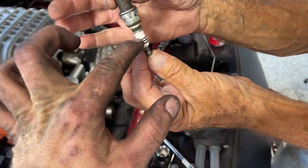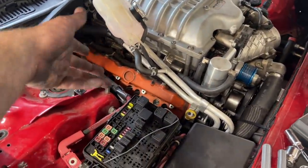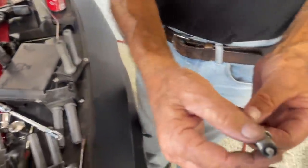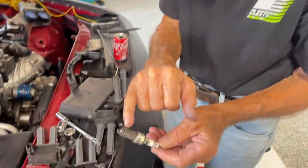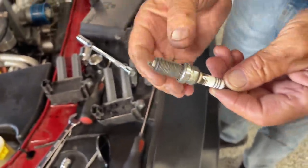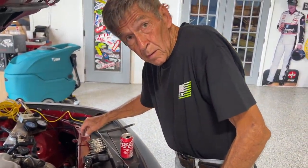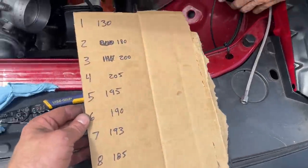You can see exhaust sitting on the plug. When I went to untorque cylinder number six, it was loose a little bit — it happens, things come undone. All the tips of the plugs look good, but you can see where it had come out a little bit on the first couple of threads. Next time we'll use the impact to put them in — just kidding.